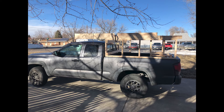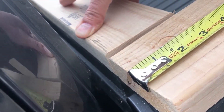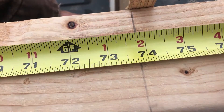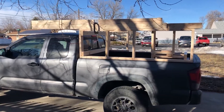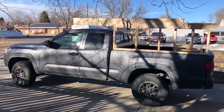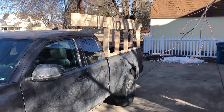I also needed to get the length and width of the truck bed so I could order the 8020 pieces. I'm measuring the base rail here — I lined up the 2x4 to where it needed to be in the front, and on the back I put a small piece of plywood as a spacer against the tailgate, then marked the 2x4 to see how long the rail needed to be. It turned out to be just under 74 inches, so I rounded up to 74, giving about a half-inch gap between the tailgate and the camper. While building this 2x4 model I was actually getting pretty excited and even thought about just building the whole prototype in 2x4s and doing the 8020 camper much later.